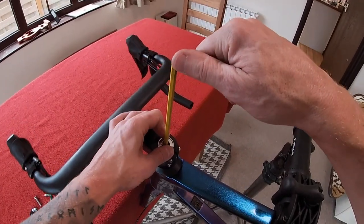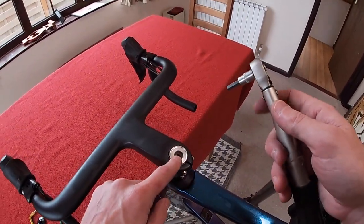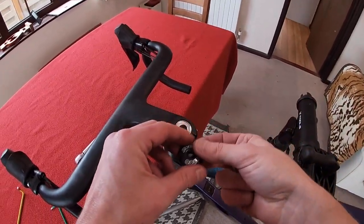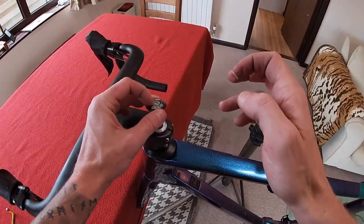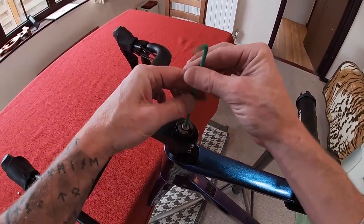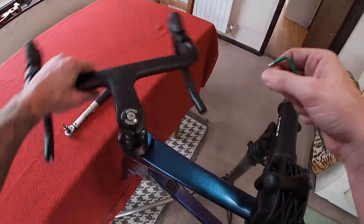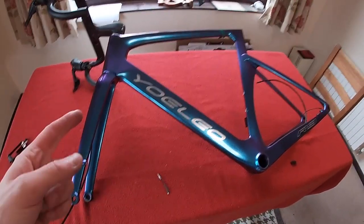Hold the top till it bites. There we go - it's bitten. I'm going to put this at 6 newton meters. I've already greased the thread into the main part. Okay, that is now on. We're going to put the top cap in with a 5mm spacer. Just grease the threads here with waterproof grease. Put that through there and put that in there. Straighten up the name if you want to. Just so it doesn't move. Doesn't feel like they're wobbling. Thanks for watching, thanks for subscribing and we'll see you on the next Karo's House. Take care, bye.